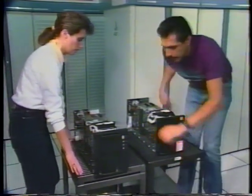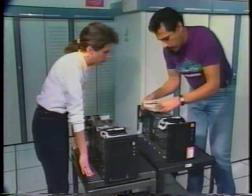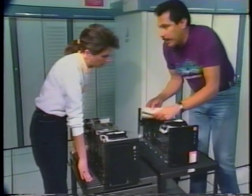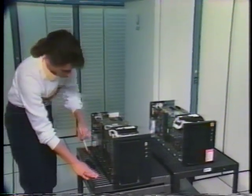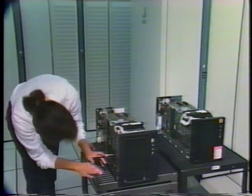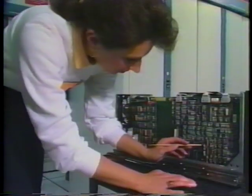Locate the defect table that is stored inside the new drive unit. Make sure that two copies are made of this document for future reference. Next, check to see if the new drive is properly optioned by comparing the settings of the old unit with the new unit.